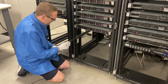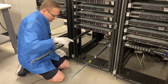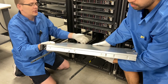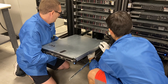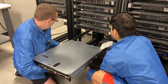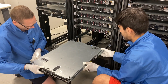So here are our rails. You will notice on your rails there are notches that are carved out — there are four of them, and that is for the rivets. These rivets that you're seeing on the side of your server are what we're going to want to line up. We are going to start with our back two rivets first. Once we got the back two in, we're going to, almost like a hinge, just drop this down into place and make sure that you get all four in.